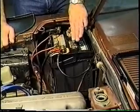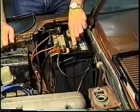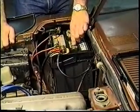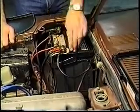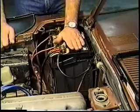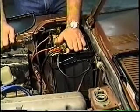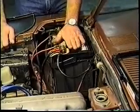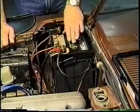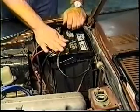The Volkswagen style is shorter but it doesn't have the amperage. The battery that Interstate builds for this application is an MT34, and they list it in every catalog they have. It's the only company I've seen producing the right size geometrically — lengthwise, widthwise, and height correct. It will give you an extra inch of clearance over the positive terminal. Get that battery. It's 685 to 700 cranking amps, which is more than enough. The original battery was probably only around 475 cranking amps, but the MT34 gives you the clearance you need.